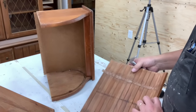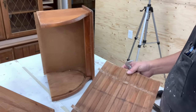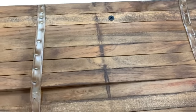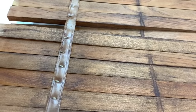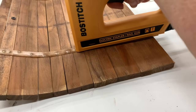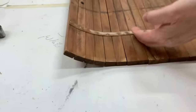Now that he has it taken apart, you can see the culprit right off the bat — on the accordion, the roll top, one of the staples had come apart. It had a loose piece and that was causing it to stick. The fix was to staple it back in place so that it could be free flowing the way that it should be.